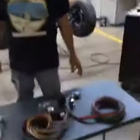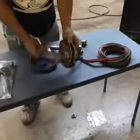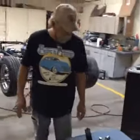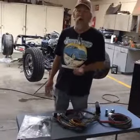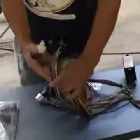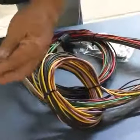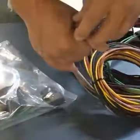I've got a wiring kit. I like to do a wiring kit — Spirit. We reference everything to what Spirit does. We use an Easy Wire kit, and the columns we use are a Flaming River column. Flaming River's column, for the turn signals and everything, has a GM plug. When you use a GM plug, they're always the same. Sometimes with Fords and Chryslers, the wiring codes are a little bit different. These just plug into a plug, and then this will plug into your steering column.